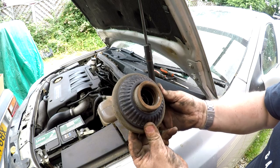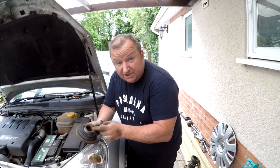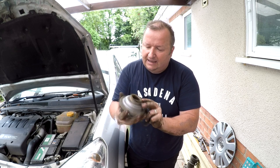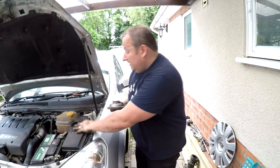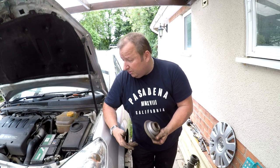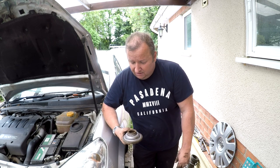So I'm going to have to tell him he needs one of these top mounts and he needs a drop link. I have access to a welder but I'm not going to try and mess about with it - I'm not an expert welder and it's right down in there, basically pressed together. There's no way you're going to get in there and do a neat weld. So let's get on to him and I'll probably end this video here and do a part two, putting it back together. As I'll be putting the drop link on and one of these top mounts, we'll call this part one. This is the real way of what you could come up against - not the same as a manual, but it's real life. Cheers, see you in the next video.